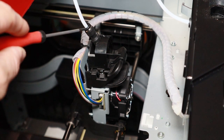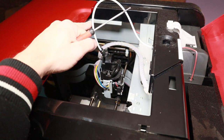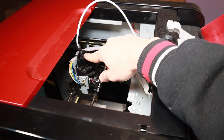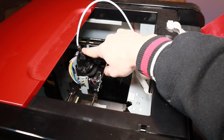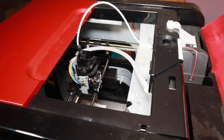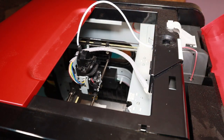Let's see if we can find a simple setup that works fine. Another thing — I have to zoom out a little bit — is that this PTFE tube is higher than the lid. This means that if we move the Y axis, the PTFE tube will hit the lid and a lot of stress will be put on the double PTFE connector. I'm looking for a way to make this better and not pulling and pushing on this PTFE tube. Another thing I'm not really happy with is this cable just lying around, so we'll see if we can find an option for that.